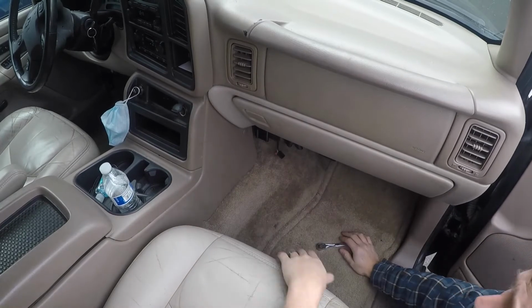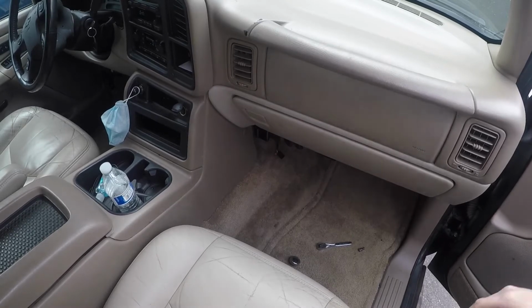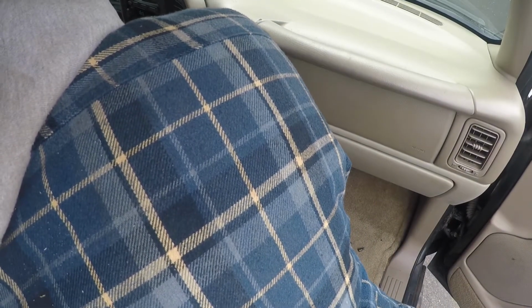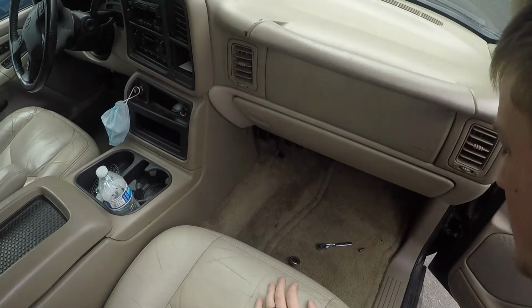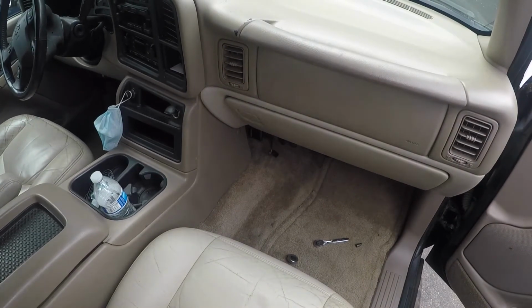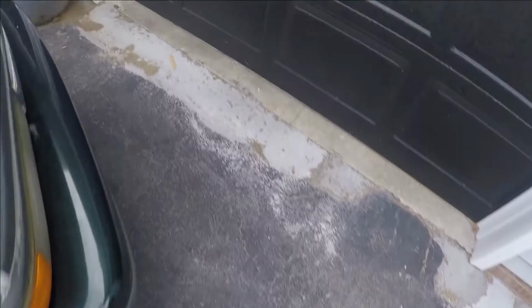Alright, so that's done there. Now, what do we got to do? Alright, so it's not plugged in, but it's bolted up. So I'm going to put this on auto 74 because I know that's what the factory is. Leave it on. Shut the car off. Let me go, I gotta open up here. I gotta grab something to pull that fuse. I'll bring you along for the ride. Yeah, it's cold. Gotta get a pair of pliers to pull that fuse out.